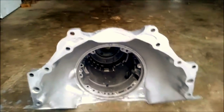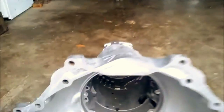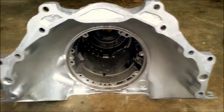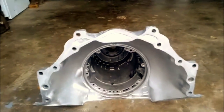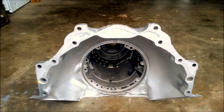We used to have these old 350s and they'd have a case similar to this for Chevrolet. For the Buick Pontiac Olds, you'd know it would go down like this at the wide bolt holes. Up like this for the Chevrolet - this is a uni-case or multi-case. The 350 would have that multi-case, or it would have the Chevrolet case, or it would have the BPO - Buick Pontiac Olds - case.